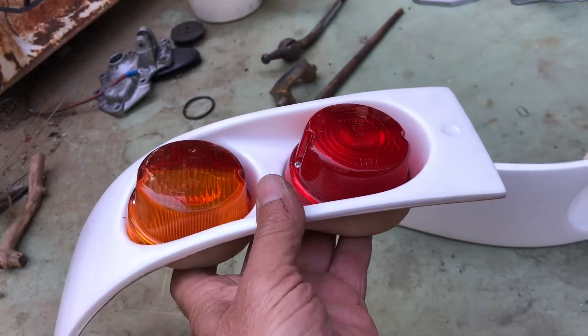You're supposed to take a two and three-quarter inch hole saw and hog out the middle, but I inspected these things carefully and decided a far better way is to fit them in from the front. These Hella light fixtures almost fit — they just sit up a bit. The metal one is what we start with; there are two of these. The brake lamp red light one has a plastic back plate. I fit the metal one into the bare raw housing, and I can tell where I need a little more space so it doesn't wobble, so I custom-fit them with my ancient five-dollar grinder.